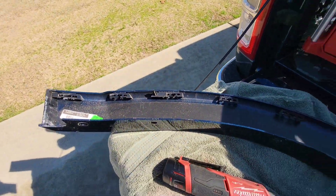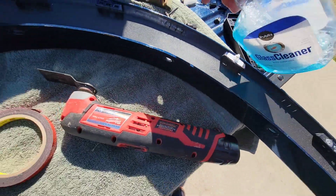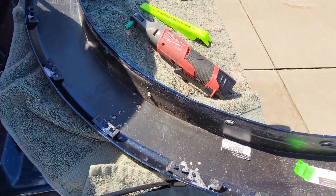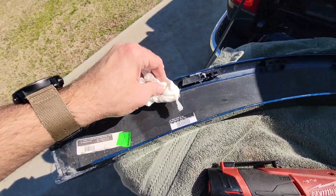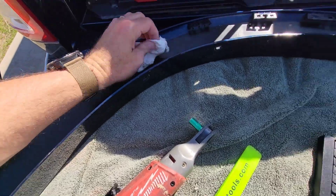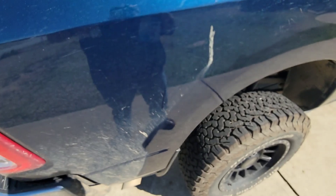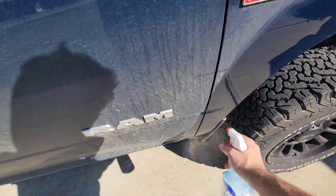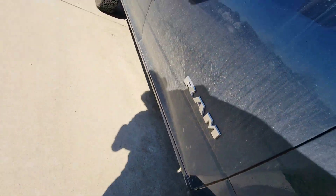Just get it as flush as you can. Looks like there's a total of three. After those have been removed, just spray a little bit of glass cleaner. You can use alcohol — alcohol is really better, but this is all I have and it'll work. After you spray these with Windex, just dry them off a little bit and let them sit in the sun to dry. My truck is dirty but I just clean the area around the fenders. This is going to allow the 3M tape to stick.